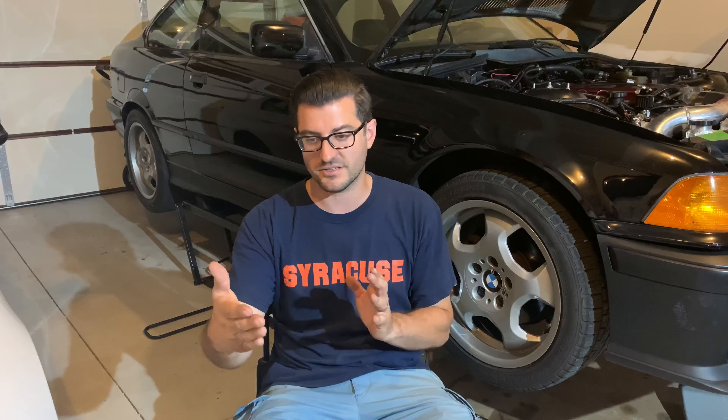It was significantly better — I really felt like this is now the best handling car I've ever had just from doing the sway bars. The tunnel plate also definitely helped stiffen things up. I don't want to adjust it to make it oversteer more because then it could get tail-happy. For right now, all the way in on the end links with the middle setting on the rear sway bar, the back end didn't want to kick out. I still modulate the pedal coming out of turns, but even when I felt like I overdid it, it didn't really kick out.